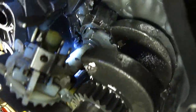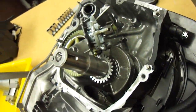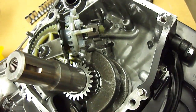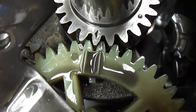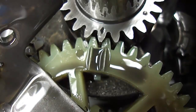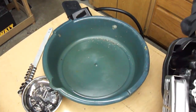So I guess this is repairable — everything in here seems to be fine. I'll check out the keyway sometime later and just let this drain with the rest of the oil, because I don't want the oil in here when I'm working on it next time. I was just making sure there was a mark on the crankshaft and the camshaft gear so I could put them back the right way with the correct timing — and they're already marked, so I don't have to worry about that. I checked this because the camshaft might come out when I tip it over, since there's nothing holding it in right now.